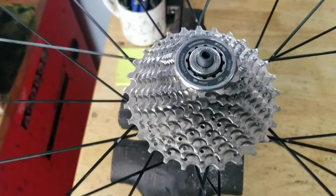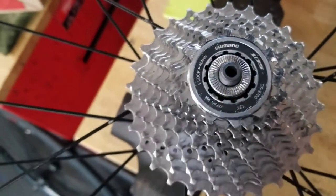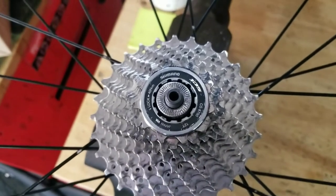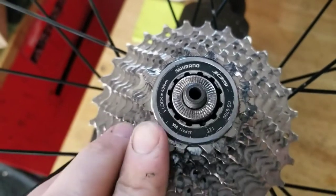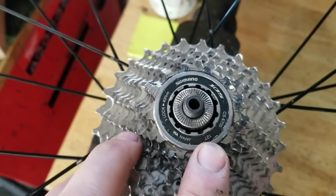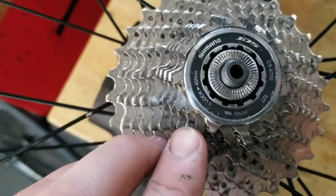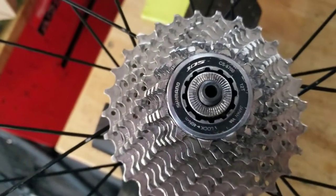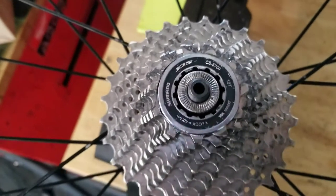Here I've got the wheel off and you can see the cassette in a close-up and everything looks to be fine. But one minor detail — in swapping this bike around with all the parts, whoever put this cassette on, this is an 11-tooth outer cog. This lock ring is a 12-tooth lock ring. So if you look in these gaps, the chain won't fit down in there, which was making it pop out. So we're going to switch that lock ring out to the proper lock ring and try it again.